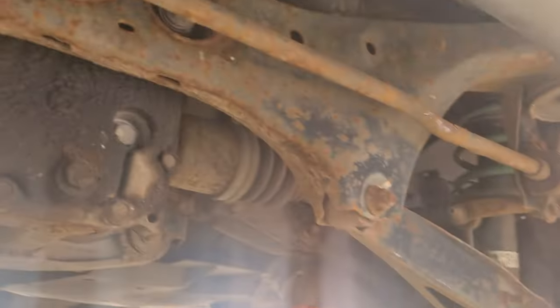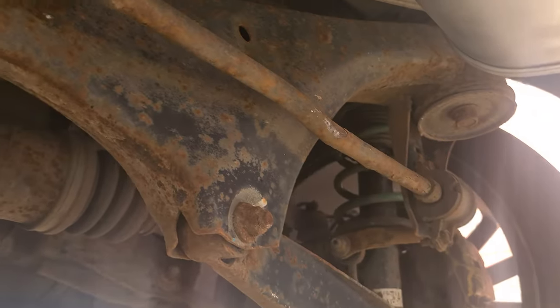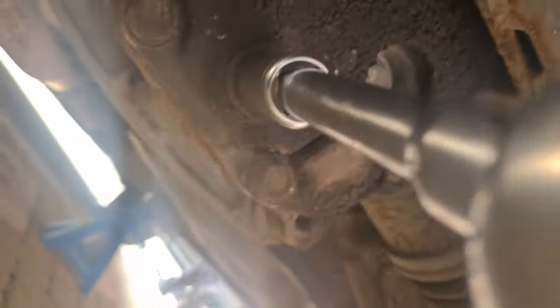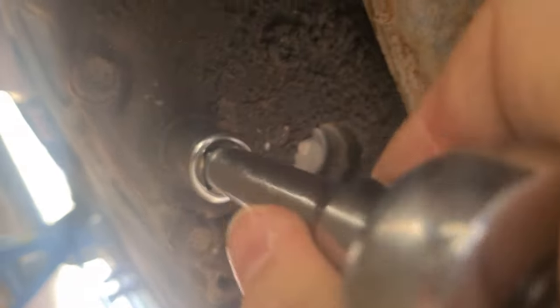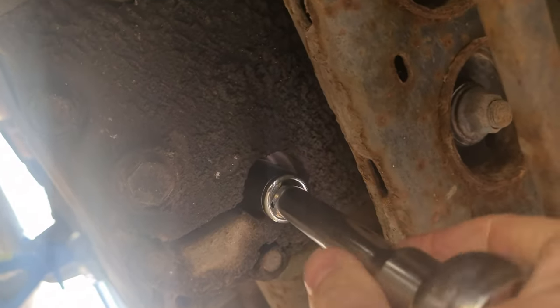Job number two. We are removing the diff oil from this one and filling up from this one here. I suspect they are a 17 mil, but when we get a socket, we will determine that Ollie is correct with his eyes and it is a 17 mil. Are both of them 17s? Oh, it's so crusty, this cover, man. Right, yeah, they're both 17s. That's both absolutely 17.